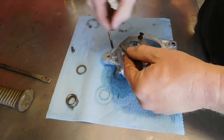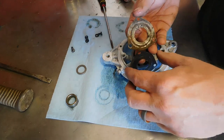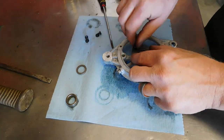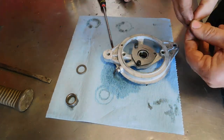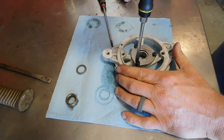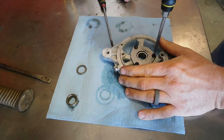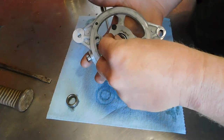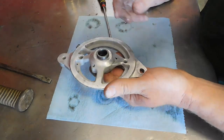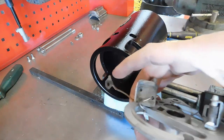Make sure the gasket is intact on your retainer as well. Take a little bit of oil. You have a narrow shim that goes on the back side and a wide one — a collar — that goes on the front. Both the front and the rear frames are indexed, so you can't get them mixed up. There's a button here and a hole there on the rear one.